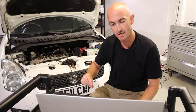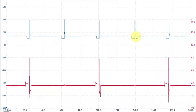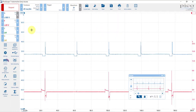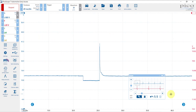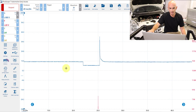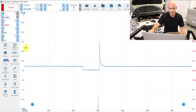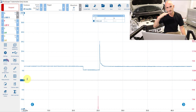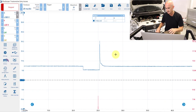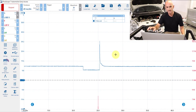There's something a little bit weird going on, so let's turn off the engine and investigate. Zooming into one of the injector waveforms, what we notice is it's not quite what we would expect from an injector. Finding the zero line, the injector is activated but it doesn't go all the way down to zero. That's because of the way they've had to configure this lead to make it work.